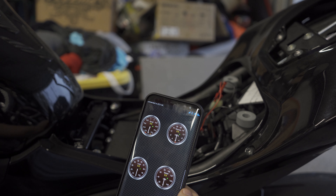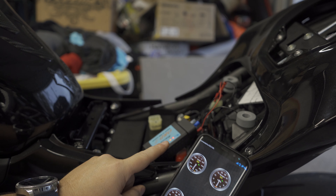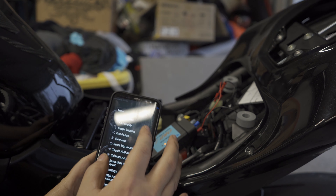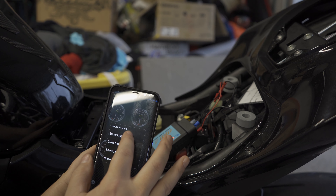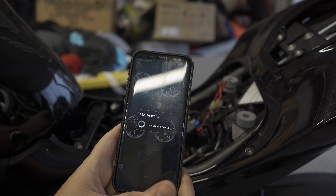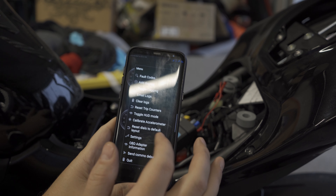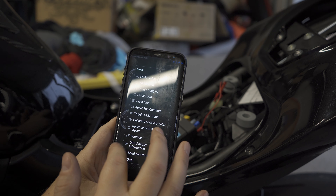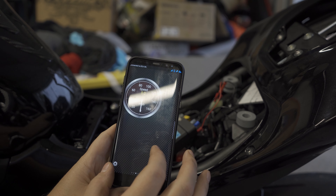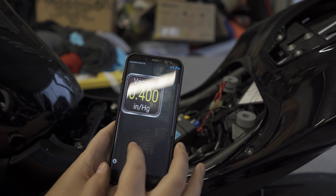There we go, finally! So it is like the fifth one. See how the lights are blinking now on the OBD2 reader. So now I can actually go in, go to my fault codes and say show log files. And it's reading, requesting fault codes. And it says there is no fault codes because I've already cleared them. You can start the bike up and look at your throttle, your vacuum, your speed, all that — it's pulling all that information.